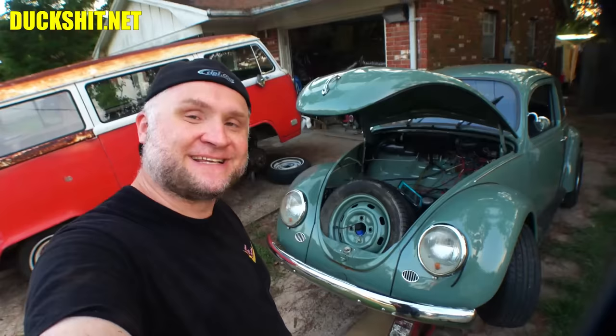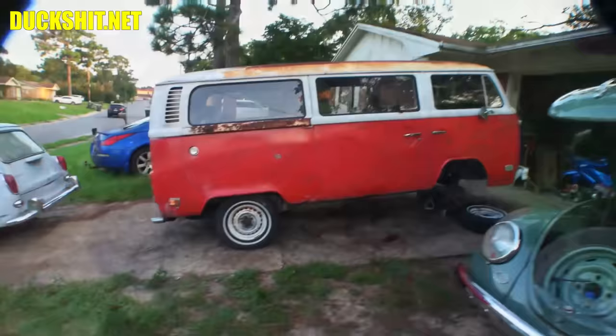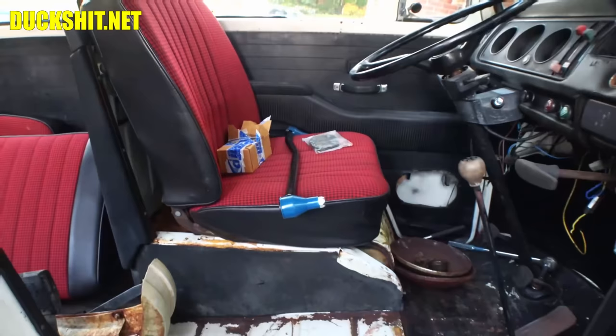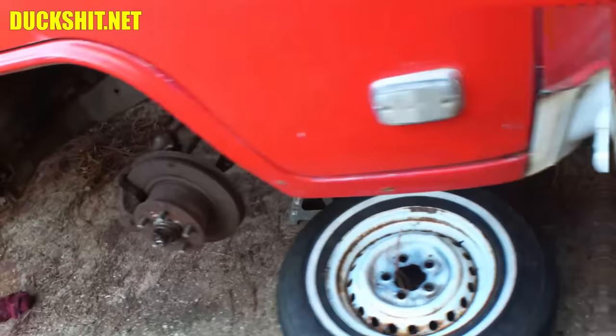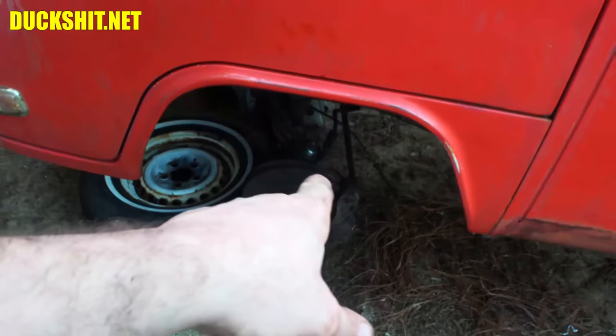Before we leave, we'll have a quick walk-around and show you what's going on with this project and a few others. The front end is pretty much all put back together with all the fresh ball joints and everything. There are a couple of components I still have to replace yet — one of which is like a tie rod but it runs forward to back, a drag link or something like that. I also need to replace a steering coupler up front. The brakes should be functional again — I didn't open up the lines at all so it shouldn't need a re-bleed. I still need to hook up the speedometer cable, which is dangling right there. All the parts are right there — there's not much to it.